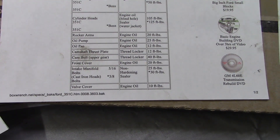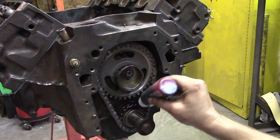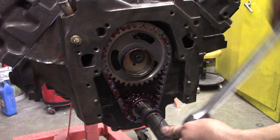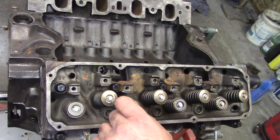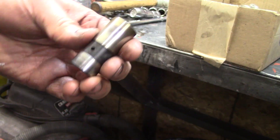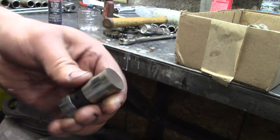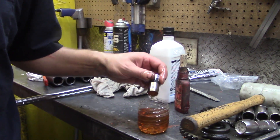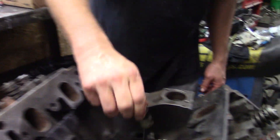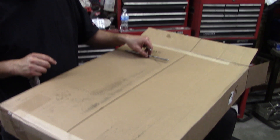This is the eccentric for the fuel pump, and I'm going to put some assembly lube in here. It seems that this kind of floats around in there. Get this washer on in the correct direction — the camshaft bolt takes thread locker here, 40 foot-pounds. This is the high-strength stuff. If you notice, there are different retainers on it, and I don't think any of these retainers are the correct ones for these springs. Here's one of our lifters — I blew it out and all that fuel-oil mix came out of it. There is wear on this; I believe there's supposed to be a little dome on there to help these rotate. We're going to put them all back in the same positions we took them out of. We're cleaning out these pushrods, blowing air through them, looking through the hole, making sure it's clear, and rolling them to make sure they're straight.